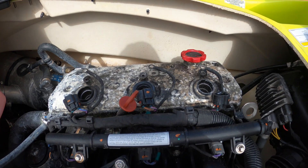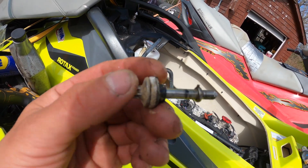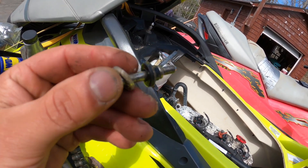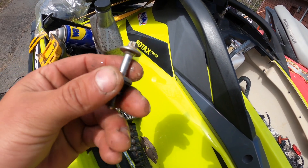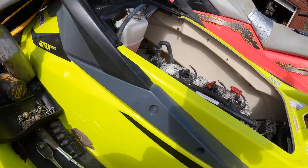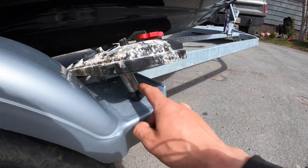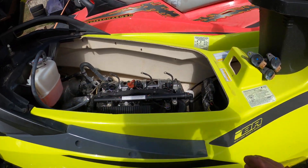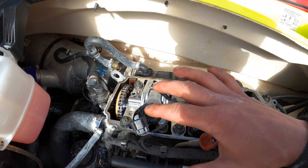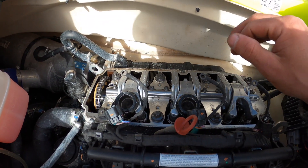I should correct myself — there are actually eight cover bolts, not six. Once you get them loosened off, you've got to grab them and pull them out because they have a little rubber seal on them to keep it sealed. As you can see it's all super oxidized, but it's a stainless steel washer so I'm going to clean those up before I reuse them. With the valve cover off, my one coil boot stuck on mine — you do not want to get any of this oxidization debris in your engine, so I'm going to get my vacuum cleaner out and vacuum off the stuff that fell down through the bolt holes.